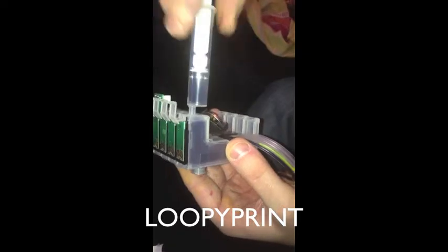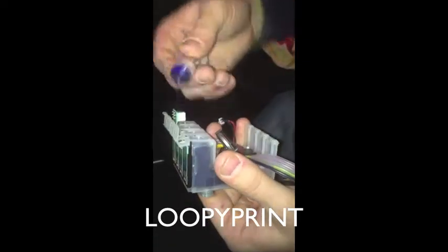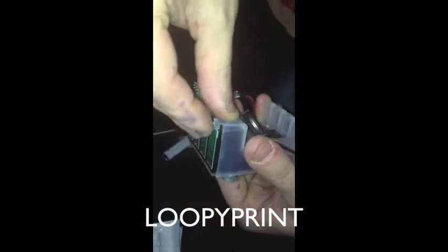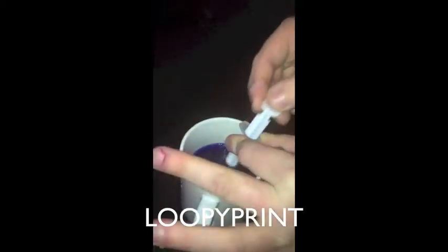Just keep on pulling. As soon as you get a bit of ink in the needle, pull it out and it's done. Replace the nipple and push it hard inside, then give it a little wipe — you don't want any ink. Now clean your syringe ready for doing the next hole.